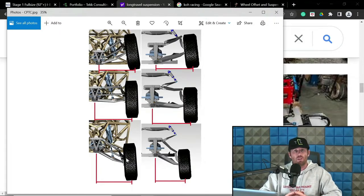What you don't want is positive camber through travel. Again, you still want to avoid that, even in the all-wheel drive setups. Now, there's people that might argue it's okay to have a degree or two in like a Silverado all-wheel drive kit. I don't think it's necessary, because I've seen guys accomplish decent amounts of wheel travel in the four-wheel drive or all-wheel drive type setups like Ford Raptors and things like that that are getting a usable 16 to 18 inches of wheel travel under 94-inch track width. And I think that is totally viable, and that's what you want to shoot for. And in those situations, we're not seeing positive camber at extension or at all in the travel, so to speak.